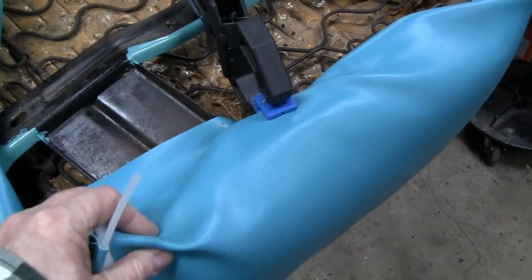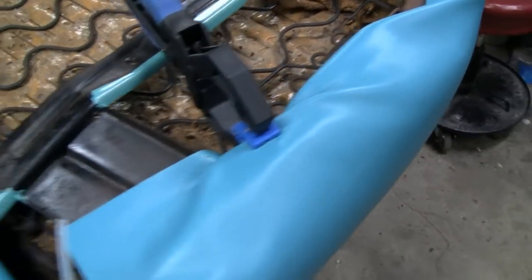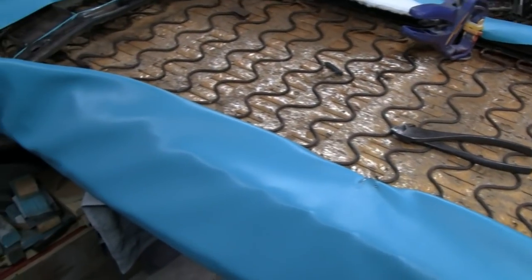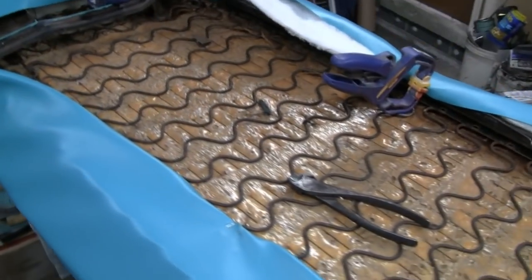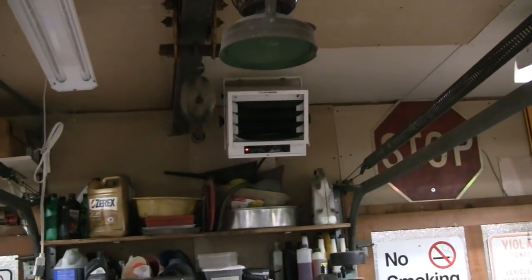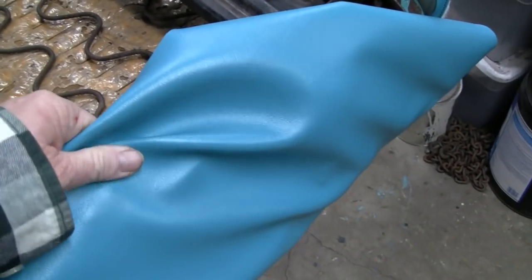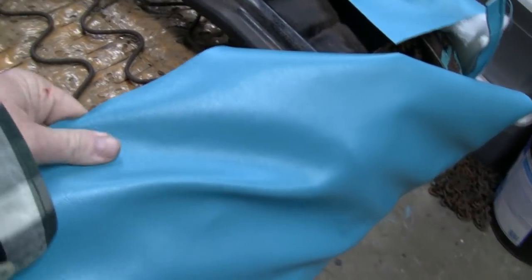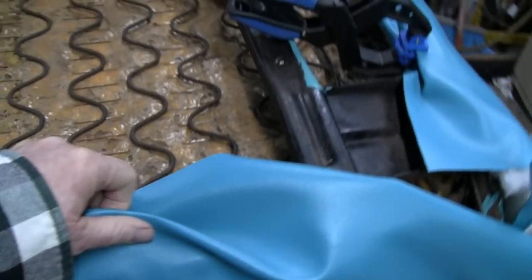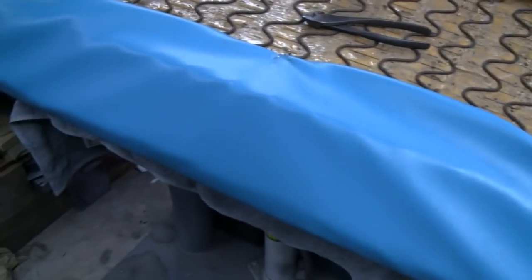This video is going to get pretty long so I'm probably not going to show all of it. I'm going to bring it in there and make the channel on both sides. I don't think I want to sew a channel on the side - I think I'm just gonna fold that and crimp it in place, we'll see. It might be a little noisy in here because I'm gonna leave the heat on and crank it up to about 80 degrees, because that's going to help this vinyl get a little more flexible. It actually feels pretty good right now at about 75, so putting it around 80 will keep it nice and supple.